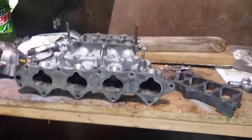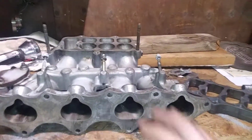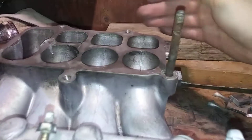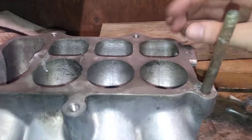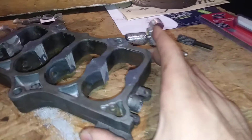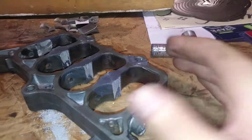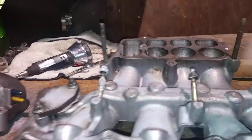What's going on guys? I wanted to go into depth on how to do a porting job and a polishing job on an H22 intake manifold. From the factory, these intake manifolds come with eight runners — two rows of four. They go across here and across there, and they have throttle blades on this mid plate with a little rod. The throttle blades open and close with vacuum depending on throttle position and how much vacuum your motor is making. Then you have your top portion — mid plate goes on top, top portion goes on top, and that completes your intake manifold.